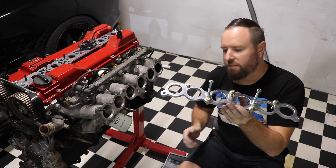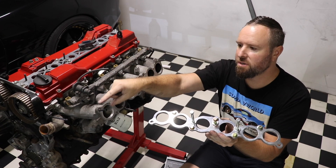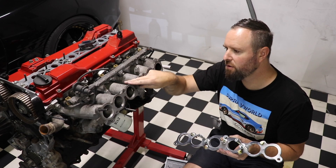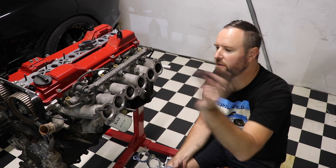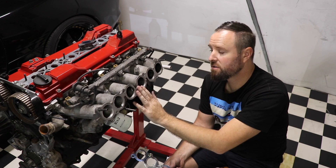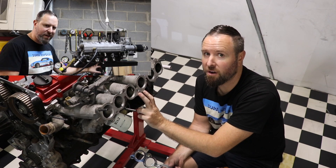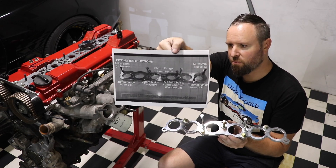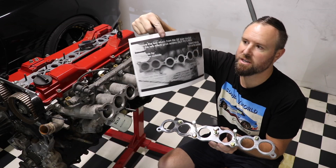When you get the kit from me you'll have the bracket and ten bolts, all different lengths. First you've got two studs or grub screws — one here, one here. There are already grub screws in there; you need to wind the original short ones out and put these 45mm or 50mm ones in place. Leave your bottom manifold on — you don't need to touch the bottom at all. Pull off the gasket; no gaskets are going to be used — we're going to use silicone instead. Clean up the surface. I've pressure tested this adapter up to 100 psi and it did not leak at all. What I give you is this instruction sheet showing everything that came with the kit and all the bolt lengths, which is very important.